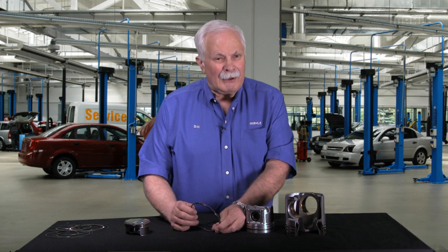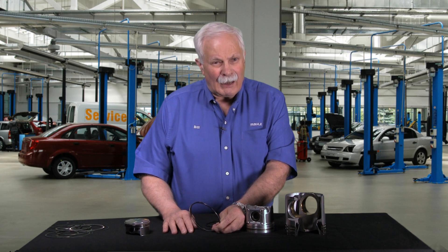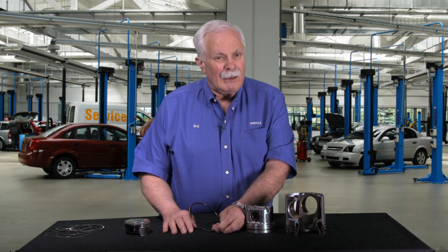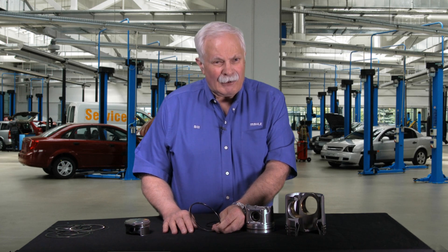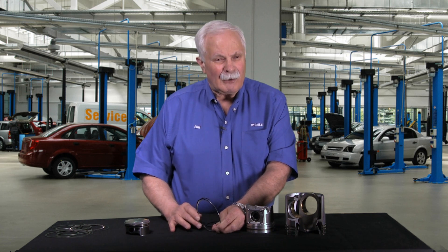The reason is it's economical to manufacture, and of course that's important when you're talking about light-duty engines to keep the cost down at the OE level. Secondly, it's very easy on the manufacturing side to vary the tension — the amount of load that ring puts out on the cylinder wall — so as manufacturers change their thinking, we can change it quite easily.